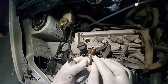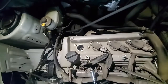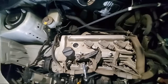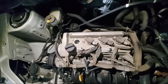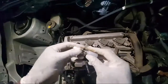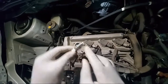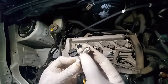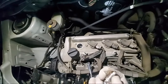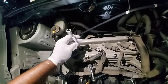You can see some little wear on the ground electrode here. Don't try to re-gap it, because this is a preset gap from the manufacturer — anything you do can compromise it. So we want to put the new one back in yourself. Take your time and put it back.